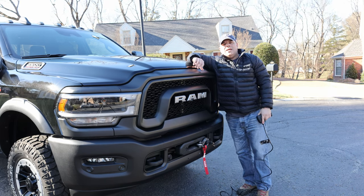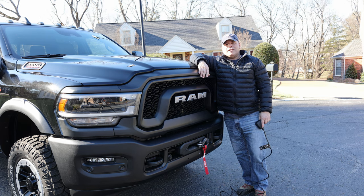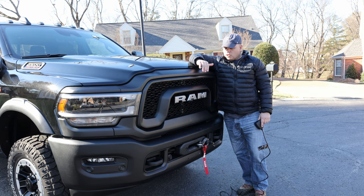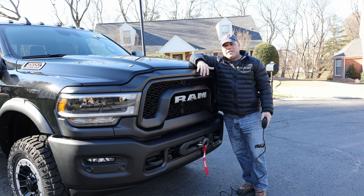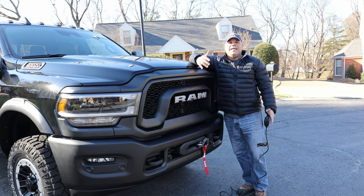That's all I wanted to do today — get that pre-tension done. If I go off-road and need to do any kind of recovery, I won't have to worry about having some sort of a rat's nest in there. The cable is pretty long — I'd say it's probably 50 feet. So if I ever get myself in trouble off-road, I just have to find a tree within 50 feet and I can pull myself out. So: 12,000 pound winch, truck weighs about 7,000 pounds — keep that in mind, especially on inclines or if you're stuck in a ditch. A lot of people don't like the synthetic cables because they do tend to break a little bit more easily, but if I find I'm having issues with that I'll probably switch it out. For now it should be just fine — I don't plan on getting myself stuck very much. The idea is to have the equipment you need in case you do, and hopefully never have to use it.